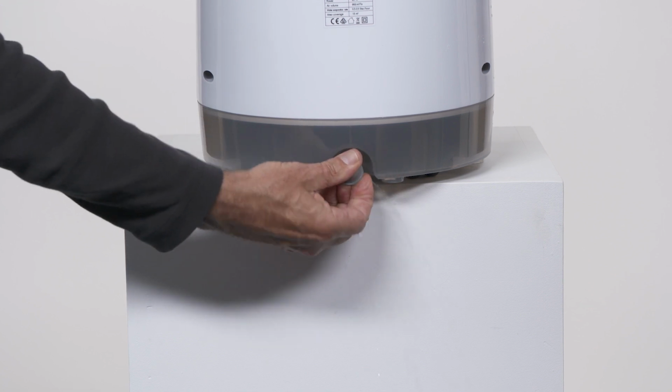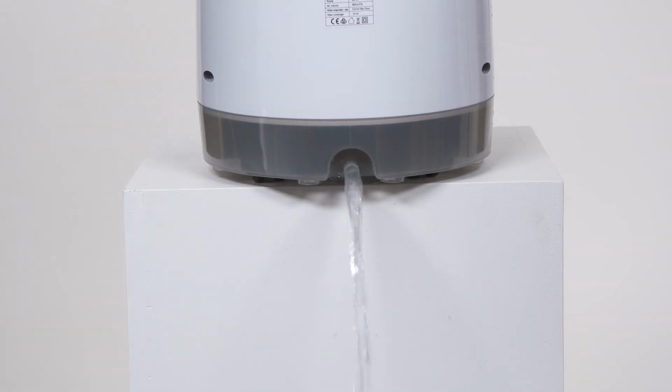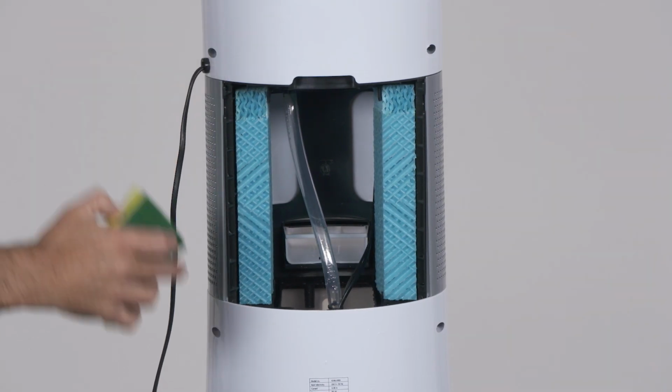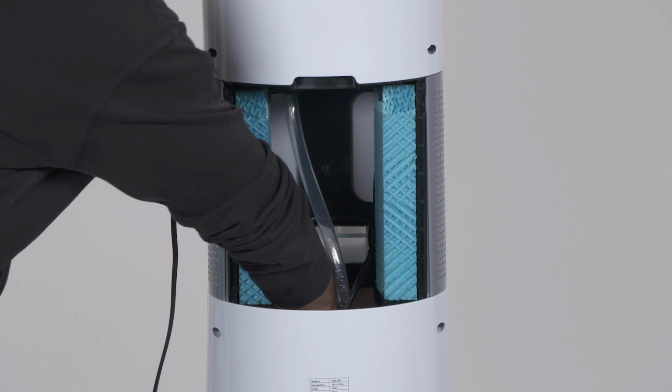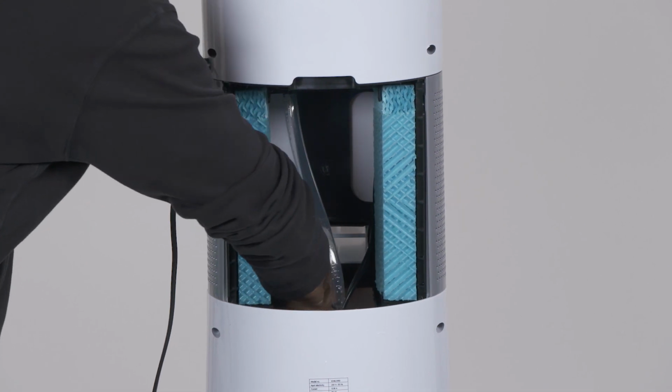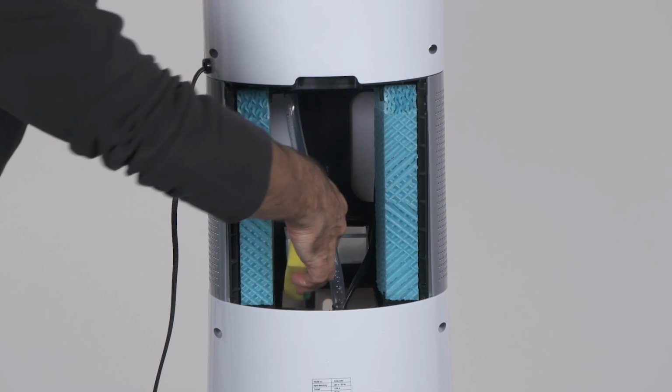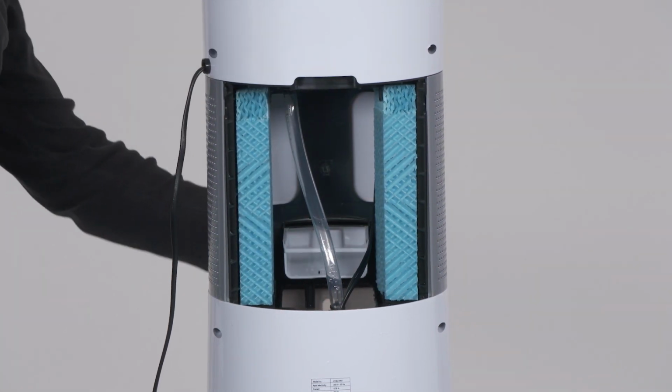To drain the reservoir, remove the plug at the bottom of the back of the unit. To prevent a spill, we recommend you take the InstaChill outside or into your bathtub or shower before removing the plug. Should you ever need to clean your reservoir, it can be accessed by removing the rear panel and reaching into the unit. The inside can be cleaned with a sponge or a cloth, but do not use soap as it will damage your sponges.